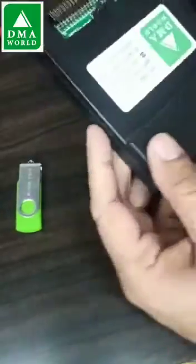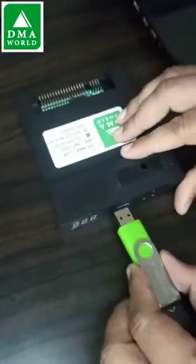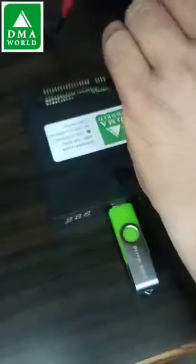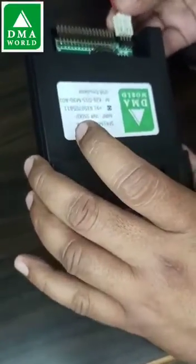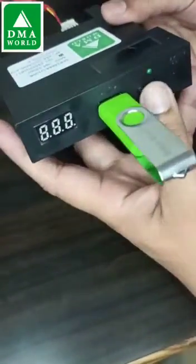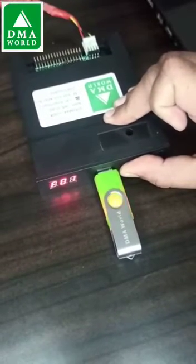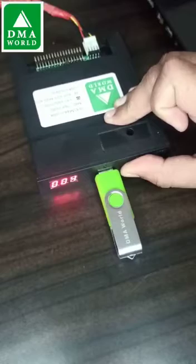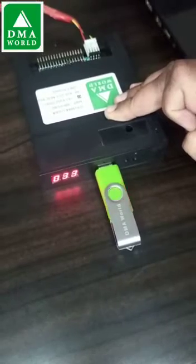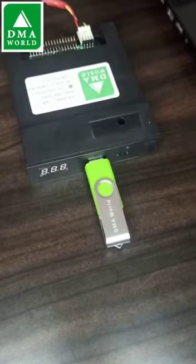This is our floppy drive emulator and I am connecting this USB disk to the floppy drive emulator. This is an unformatted USB disk. I am connecting the 5V DC power connector to the USB emulator. Now I have to press these two buttons simultaneously then power on the emulator. This will format the USB stick. You can see on the display it is changing numbers — it means this many partitions are going to be built. This was the formatting.